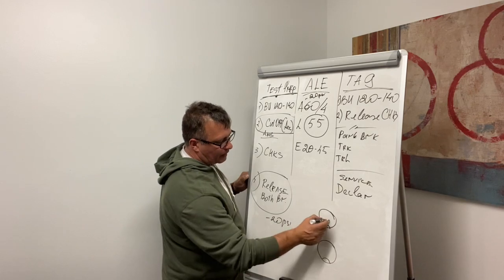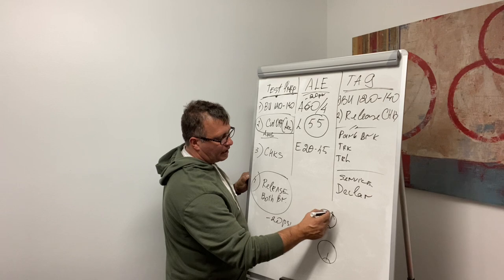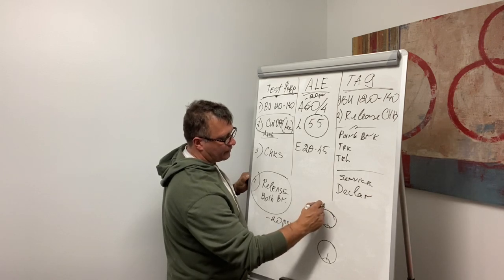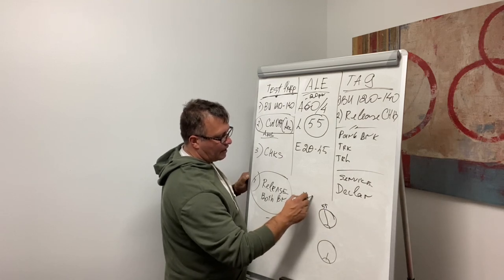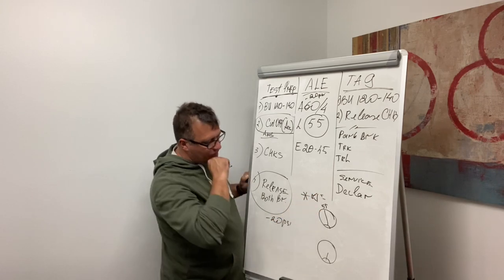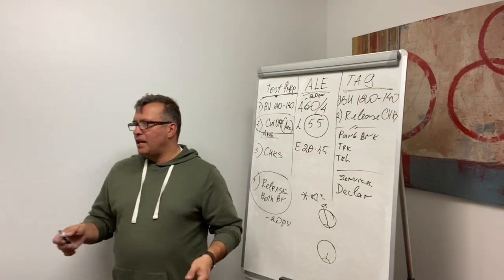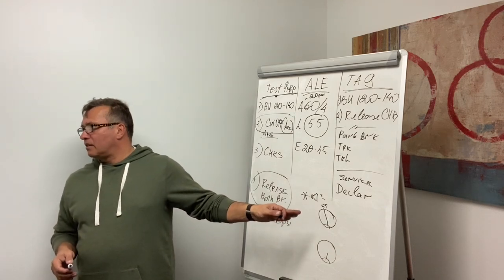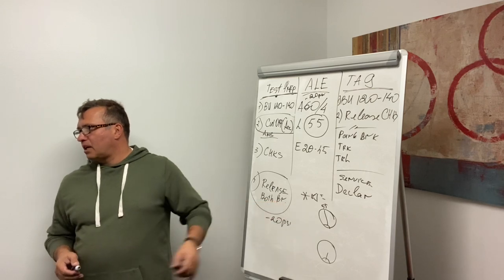So, this is your air gauges. Primary gauge going to 55. Buzzer and light start to sound. Here, you just take your foot off, start explaining, and then it goes off, both of them. And it's quiet, and it stops. No buzzer, no light. What happened, what do you say?